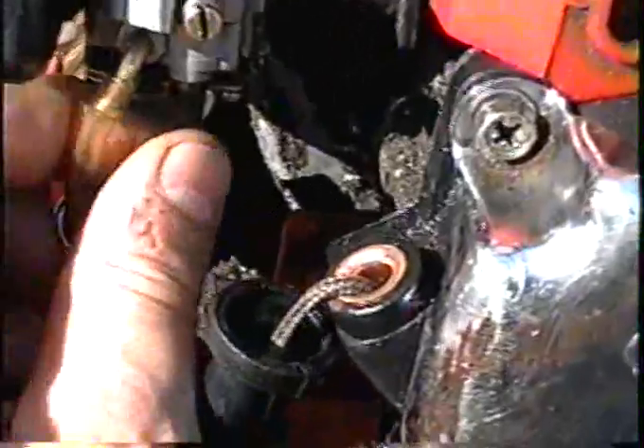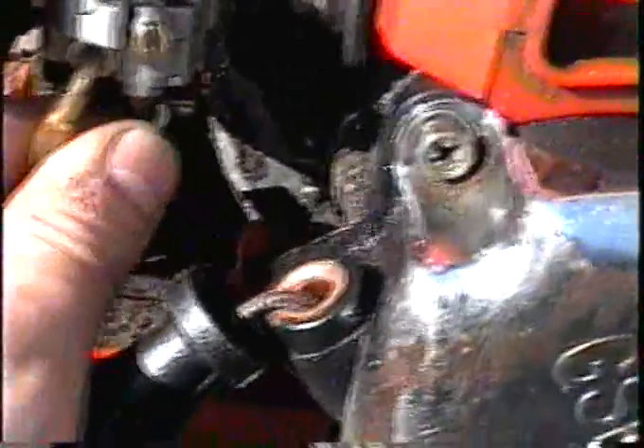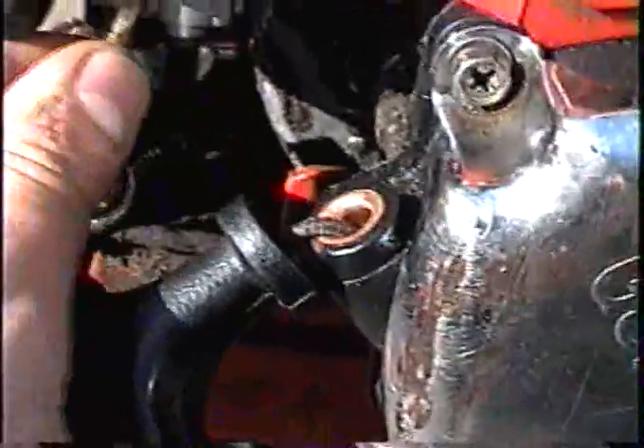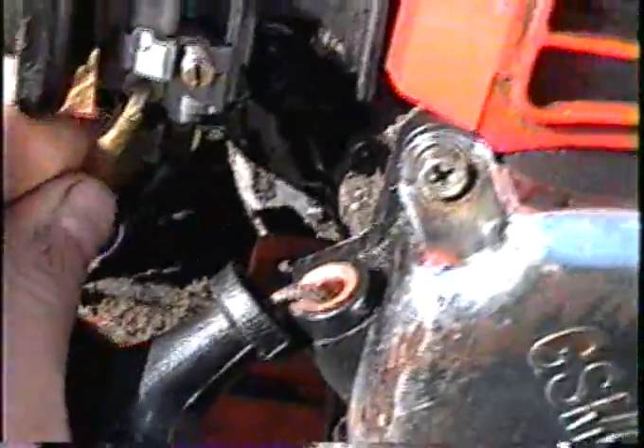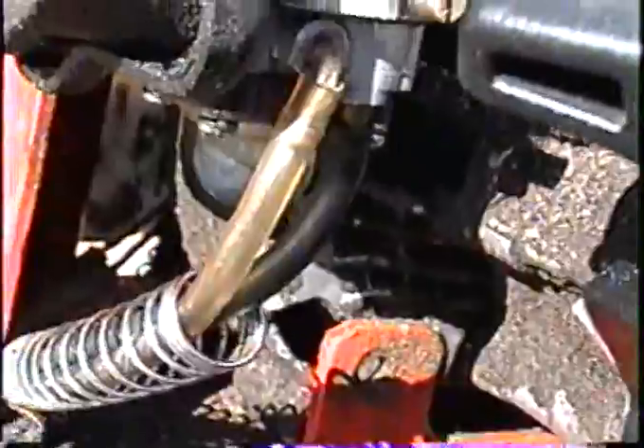This is just to give you a basic idea. You also want to make sure that these two fuel lines here are nice and snug onto the nipples of the carburetor — this one's a bit loose, so I'm going to put new fuel lines on this thing. And you want to make sure your primer bulb underneath is in good condition as well.